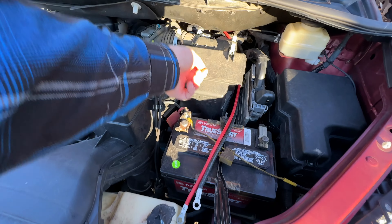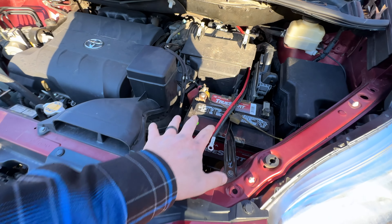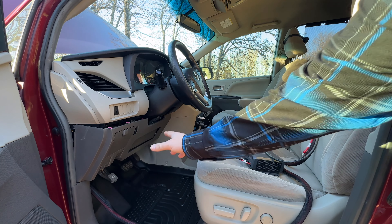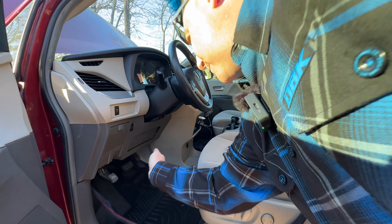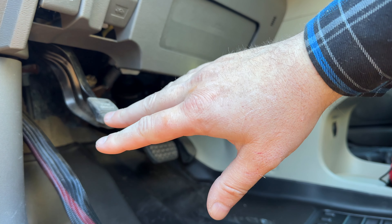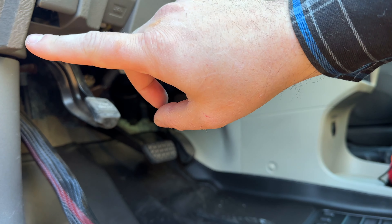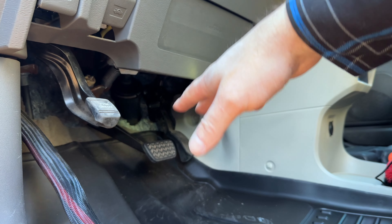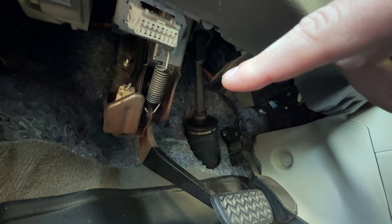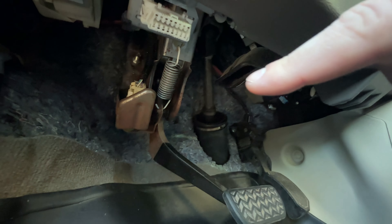This is a case of don't ask me how I did it — I did it and it was hard. I managed to push the wires through from that side and then used a hanger to pull them through the rest of the way. To help ease the process I popped my dash down, which simply just pops up and down right out of the way. I routed the wires up over the steering column, well out of the way of the brake pedal or the gas pedal, so they won't interfere with any driving functions while going down the road.